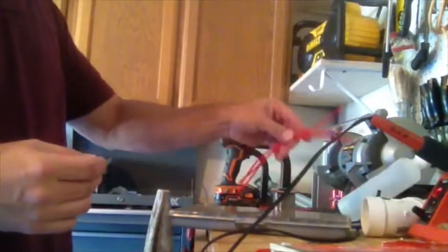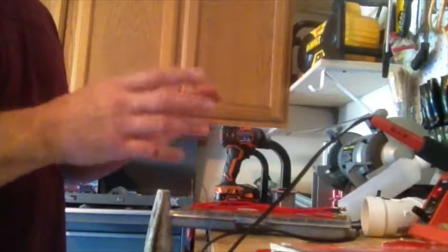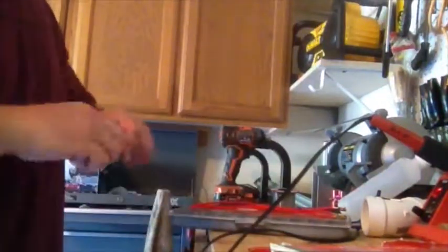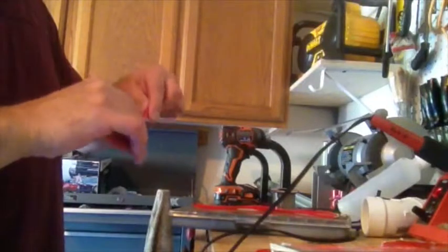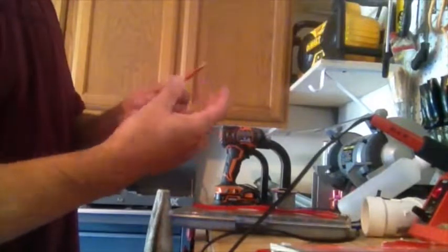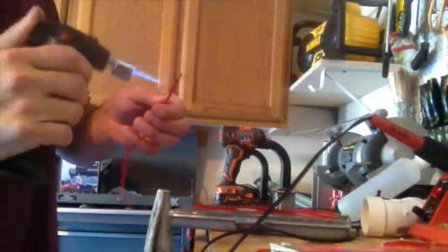I'm creating a wire harness for 6 wires to go through the firewall and connect them all to that relay box. And then I'll have it all nicely bundled in right by the FJ where all the buttons are going to go. I want to keep track of them, so I'm getting these little shrinkable tubing pieces and numbering them. That way, when I have all the wires together, I can tell which wire goes to which relay, and it just makes it easier to keep track of all the wires. Just a nice little tip.